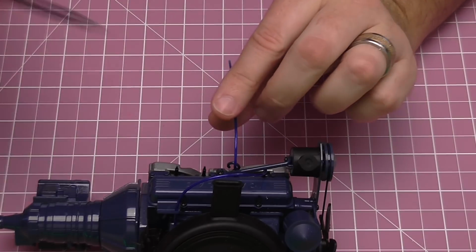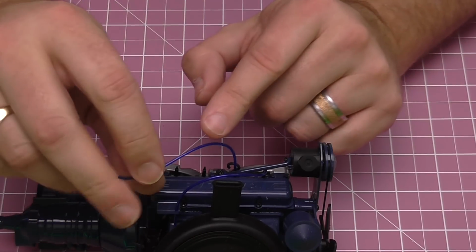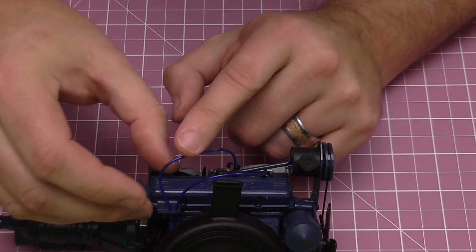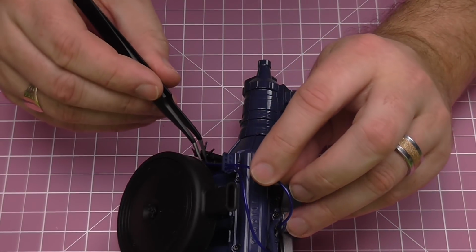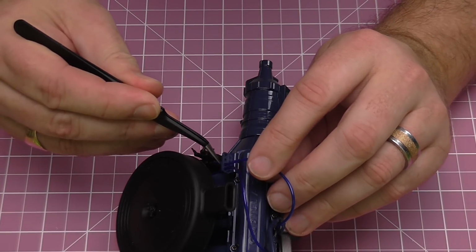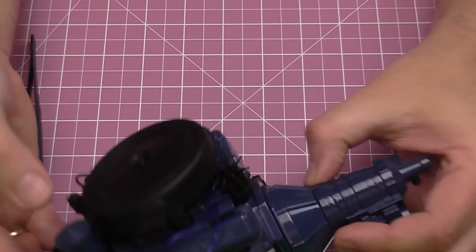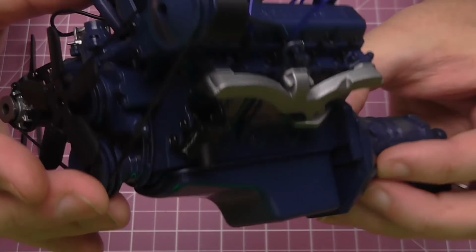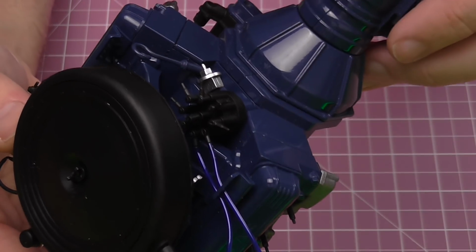The second spark plug they've got going over the top of the brace that we put in there. So we put that over the top, again through the tidy there. Ignition coil tidy, I think it was called. I can't remember the name of it. And then we're going to put this into the next plug along on the distributor. Just like that. That's the second one in. Going through there and then onto the distributor. Don't know if you can really see that, but that's on the distributor there.